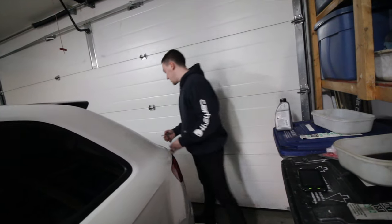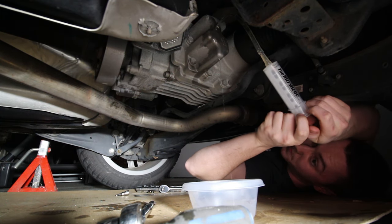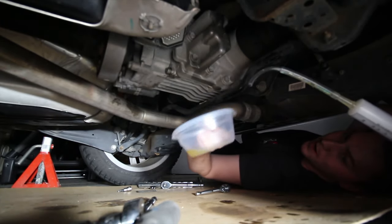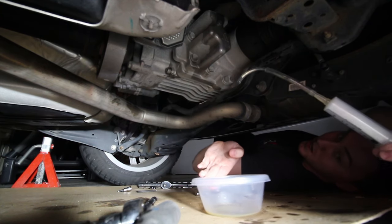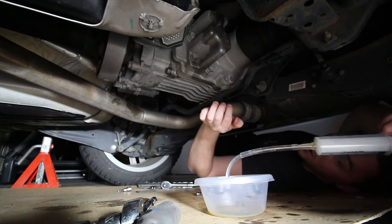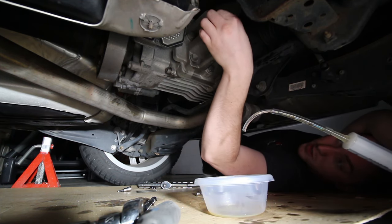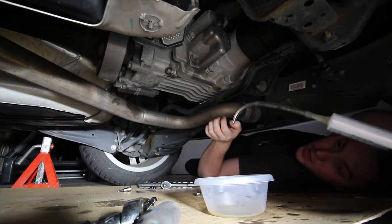After what felt like forever doing this, she's full — a little bit of drippage. We were using a brand new zip-lock style container to catch the fluid that came off the Haldex housing so we weren't wasting anything. The housing is clean so we can reinstall. We got about 700 mils in the Haldex at 25 degrees Celsius, which is within filling spec. We let some overflow out to confirm it's full, so we're going to fire that plug back in, snug it up, drop the car, and go take it for a drive.